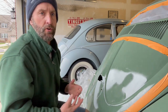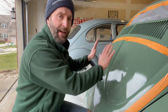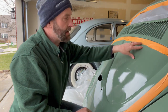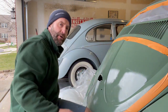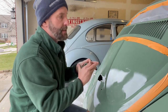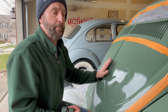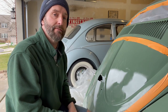So what I'm thinking I'm going to do, and what I think will work, and we're going to see if this happens, is my horizontal movement is correct. I don't need to touch the brackets any longer. So those are 6 bolts I don't have to worry about. So what I'm going to do is unbolt this side of the hinge, the deck lid, and loosen this side up and kind of flip this a little bit so I can get up underneath there and install this spring. Because when everything's bolted down, there's just no way you can compress this with it being completely bolted down. So the thought here is I've only got now the vertical, the up and down to worry about. And that's 4 bolts rather than a complete total of 10. So I'm gonna give it a shot. Cross your fingers.